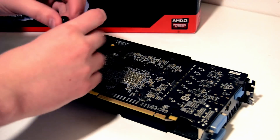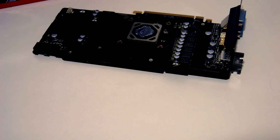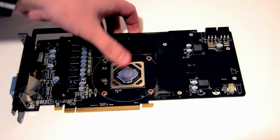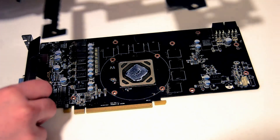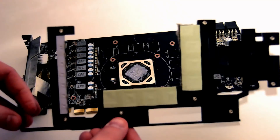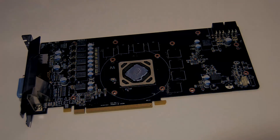Disassembly is easy for this card — simply remove the 4 screws surrounding the GPU to release the PCB from the heatsink, and if you want to remove the back plate, remove all the other screws on the back. We get a nice chunky heat pipe and fin arrangement as well as a nice strengthening plate. The one working fan felt a little grindy and spun a lot less freely than I'd have liked, and the thermal paste had started to dry up, likely due to the lack of heat dissipation from the broken fans. These issues would certainly account for the thermal spikes and shutdowns that the seller reported.